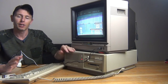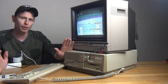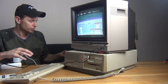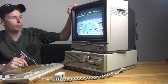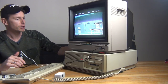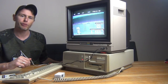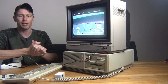So that's it for this video — restoring this Commodore PC-10 III to working order. There were a lot of challenges: the hard drive, as you remember, you cannot use an IDE hard drive; the keyboard was a real challenge but we found a converter for that; I replaced the drive to fill the hole; and we found a monitor that works. Probably if you're American with an NTSC monitor you won't have as much trouble as I had, but for me this is the only solution with the Chinese converter. Thank you so much for watching and I hope to see you next time on the Retro Game Couch.